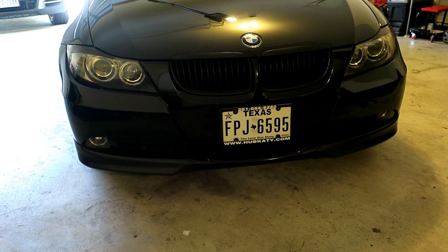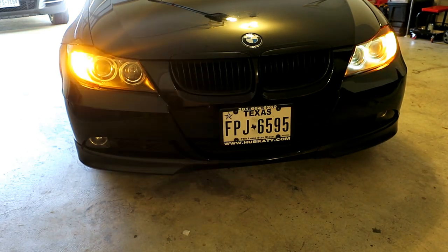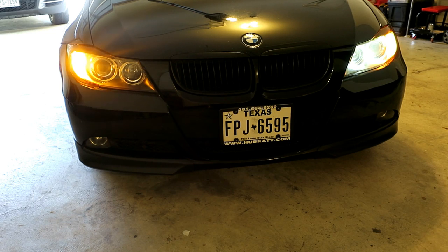Today I'm working on my 335i. Notice I had an issue with my angel eyes. If you've been following my channel, you'll see that I changed my angel eyes from halogen to LED, and I bumped the voltage up on them by coding them, and I also coded them to be my DRLs. So if I unlock the car, you can see only the driver's side comes on, and I think I know what the issue is here.